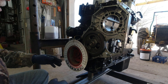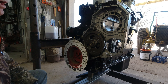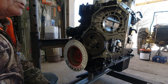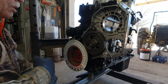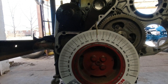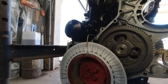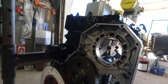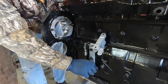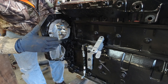We've got our pointer fabricated and our magnetic degree wheel stuck onto the front crankshaft pulley. We're going to do this with the cover off — it'll be a whole lot easier for you to see, and easier for us to do as well. You want to make sure you've got this bracket on the motor. Leave it loose until you get your bolts started — it supports the back of the P-Pump. Without this bracket, it'll break your timing cover.